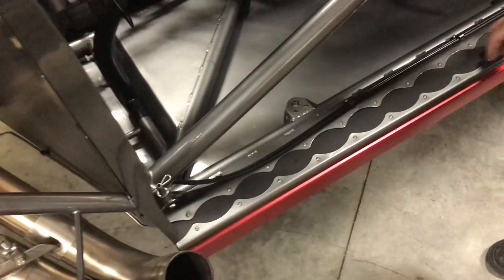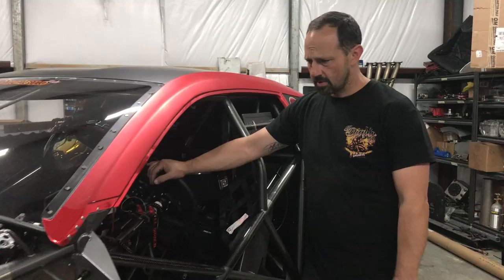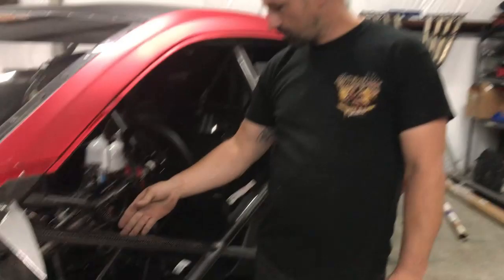By running the coil on plug, it kind of saves on belt life. Inside the car, we do some lightweight options. We scallop all the steel pieces — it just takes out all the excess weight. Also on the door, all the door provisions are scalloped, and titanium window frames. When building a small block car, this car was specifically built for a small block, so we tried to build it as light as possible without jeopardizing any strength.